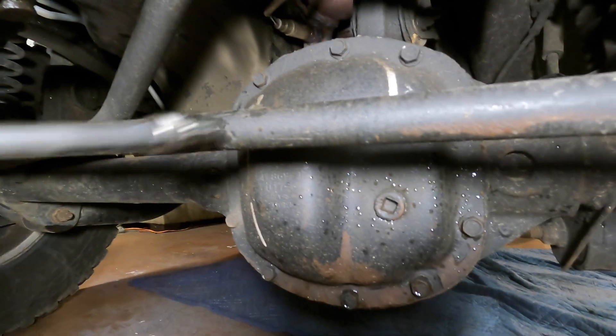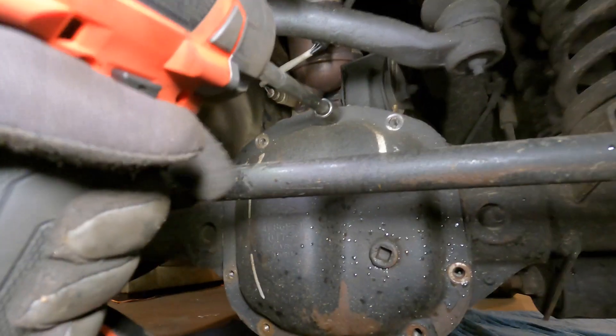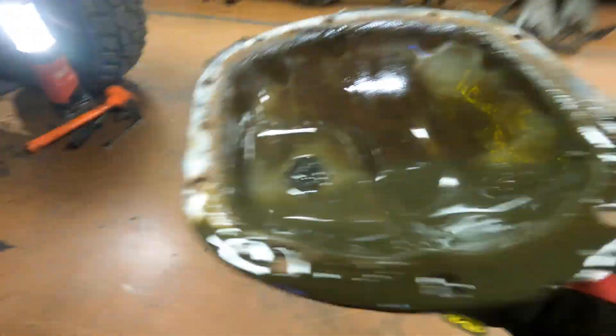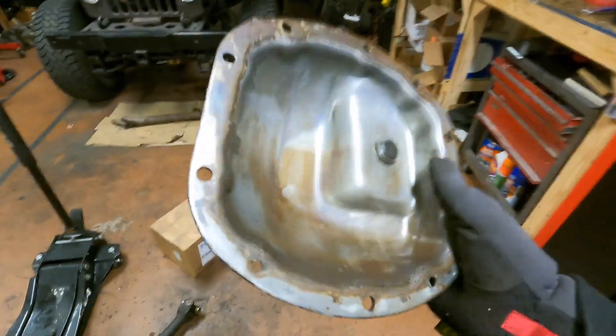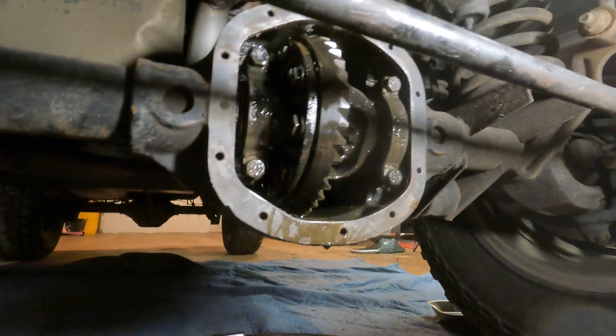We've got four - well, three - well, not even two eight-millimeter bolts and whatever hex size I used on the front. Get the front diff cover off. I always leave the top bolt last and don't remove it all the way, just loosen it so the fluid comes out but the diff cover itself won't come flying off. That fluid doesn't look the healthiest, but it still smells like diff fluid. Got that cleaned up, scraped off, and ready for a new gasket. Going to scuff it up a little bit and repaint it - using the wheelbarrow paint. Housing is cleaned up and ready to go.